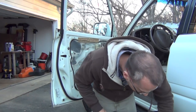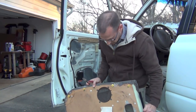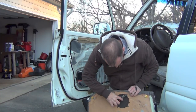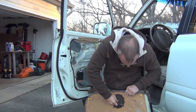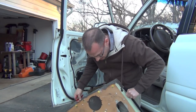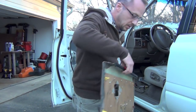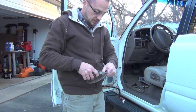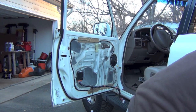What I do is I use sharp wire cutters. I go underneath right here by the speaker and I'm just clipping this little washer thing — it twists and it comes right off. You've got to break it and then twist and you can get it to come right off, because you don't want to ruin these little studs — we're going to use those to hold it back on with the method I'm using. Now that speaker hole is there and that's all we need to do to the door panel. This last one just kind of wiggled out without even taking it off, so now we've got our panel.